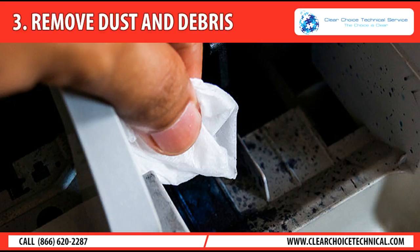A quick fix is to remove particles using a small vacuum. This is preferred over using canned air dusters because it removes the dust instead of spraying it around the inside of the printer. You can go further by using a cotton swab and purified water to clean the ink cartridges. Most manufacturers will provide specific instructions in the printer manual or online.